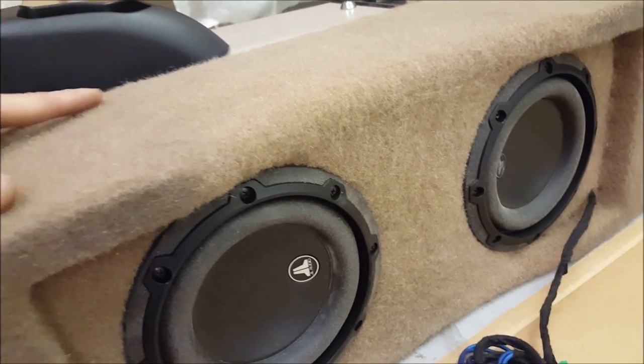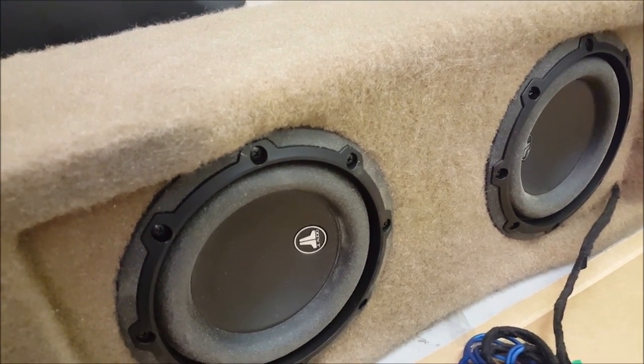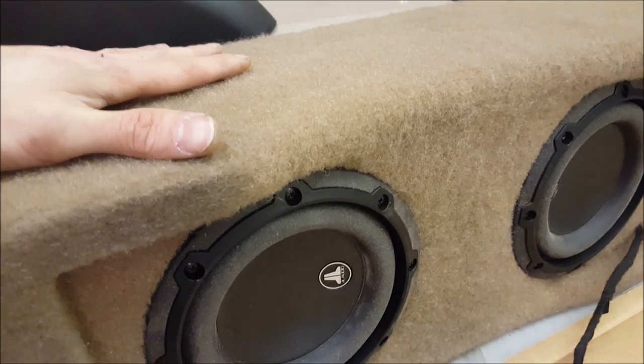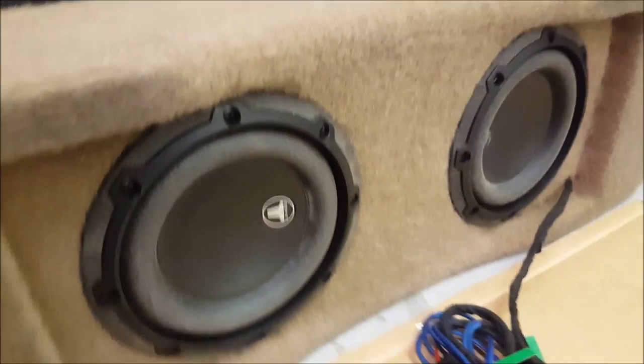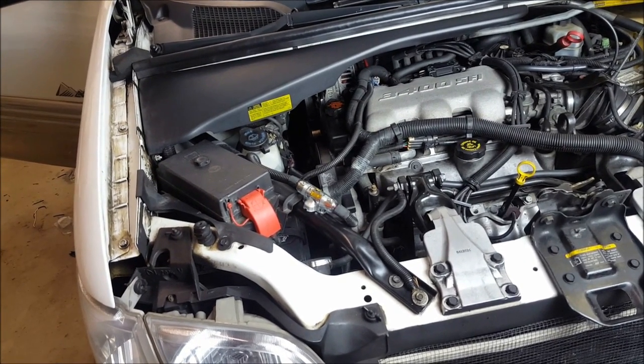We have the air volume that we need. I don't expect this to be that loud — I expect it to sound like a very good complementing bass, the equivalent of a regular 10-inch in a sealed enclosure. But I couldn't build an enclosure this narrow with a 10-inch sub, so the six-inch JL subs fit perfectly. I was actually able to wrap the whole thing in one piece of carpet with no seam lines. Keep in mind in this video I'm just showing the finished product — check out my how-to section on my channel for detailed installation guides.